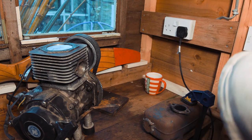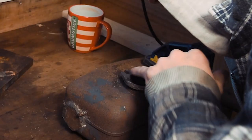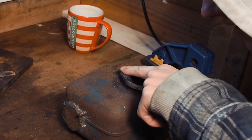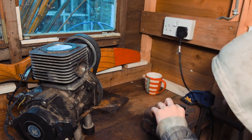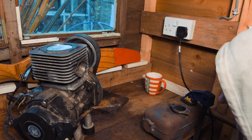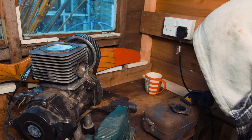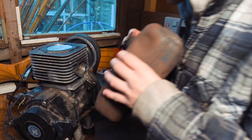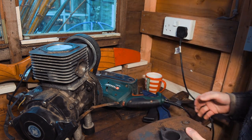It looks like this top edge was quite high as well, so we're just going to keep going until we can see the shiny surface all the way around this. We've got quite a thick flange here, so we've got plenty of material to work with, but we don't want to take all of it off. We've got little divots where the original material is, and then you can see over here that it's smoothed off now. We've still got a low side just here on this side which would cause an exhaust leak if we leave it like that. The trick here: keep checking — don't take off too much material to maintain the integrity of the exhaust. That is much better by a country mile, but we've still got a high side on this side, so I'm just going to attack that a little bit more.